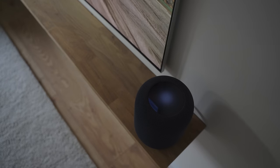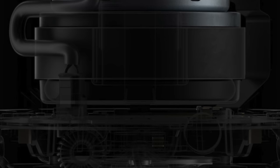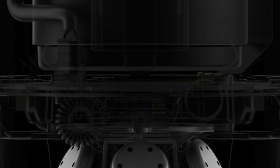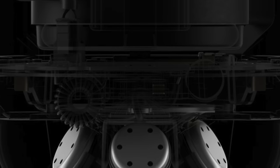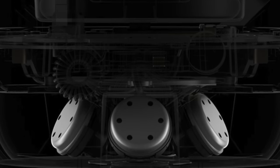What most people don't understand about the HomePods is that they're omni-directional speakers — fundamentally different to how most speakers work. Most speakers have a single front-facing tweeter, and treble sound is quite directional, so going off-axis changes the sound dramatically. With the HomePods, there's an array of beamforming tweeters all around the device projecting into the room, so as you move around, your experience of the treble sound doesn't change. That said, there are still standing wave issues — you can still detect big variation in bass response depending on where you're sat in the room.